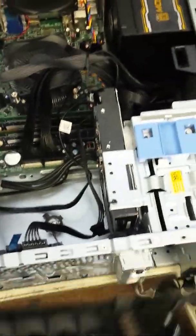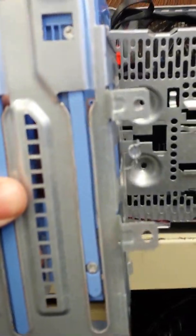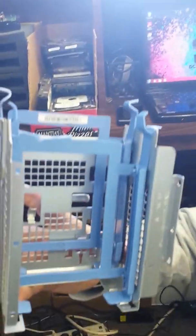If you take the faceplate off, there are two rivets here that can be drilled out. Those are what holds this in at this point on the inside. Then there are three rivets here at the bottom — these three holes which line up with these three holes on the inside. Again, those need to be drilled out. And then on the bottom there are three more rivets, and those line up with this part of the hard drive caddy.